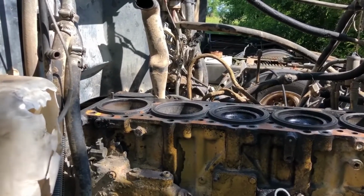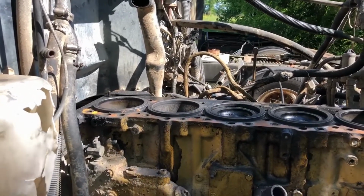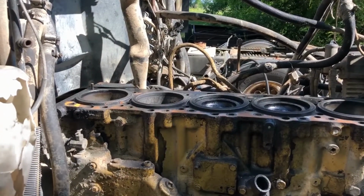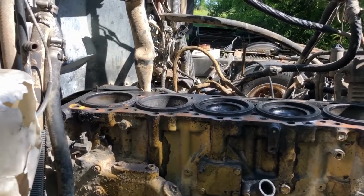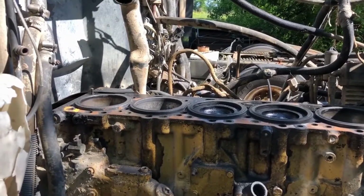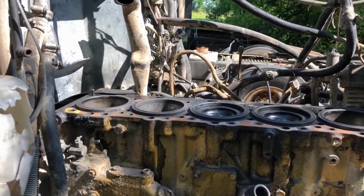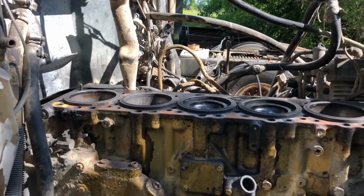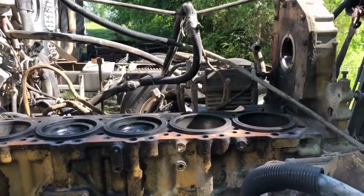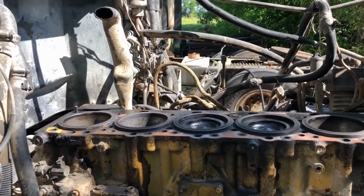But I've seen KT3406, his YouTube channel, very informative on his engines. I'll put a link below. I'll also link Adept 8 down below. They both have wonderful videos for this stuff. KT said, even buying a new head, they're usually not flat on the bottom. So even if you buy a new head, you probably should take it to a machine shop and get it surfaced. So I don't know, we'll see.